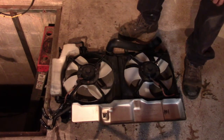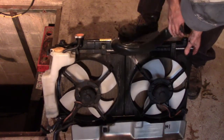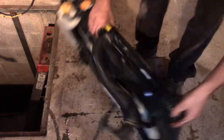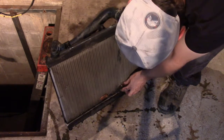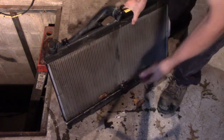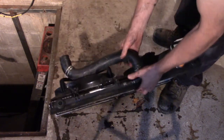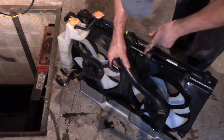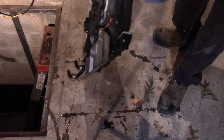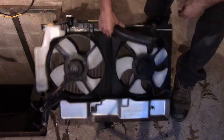Now the only thing is when you get the new radiator, transferring all the stuff — but who cares, it's out of the vehicle. If a fastener breaks, it's no big deal. Let's see what that hole looks like — oh, nice and wet in there. It was on the top of the radiator right about here. Let me get these fans and shrouds off of here and transfer them over to the new radiator when I get it. Wow, that was amazing.